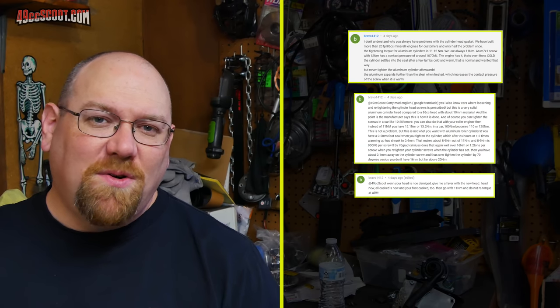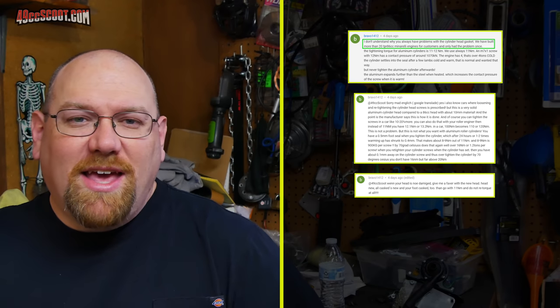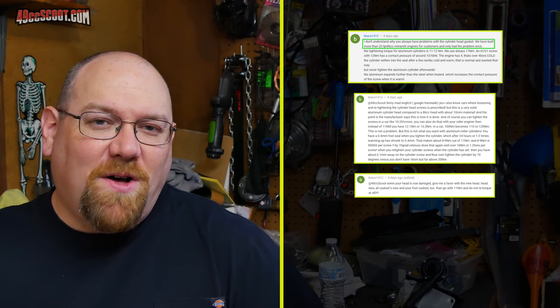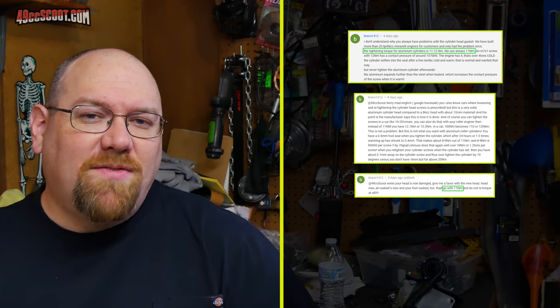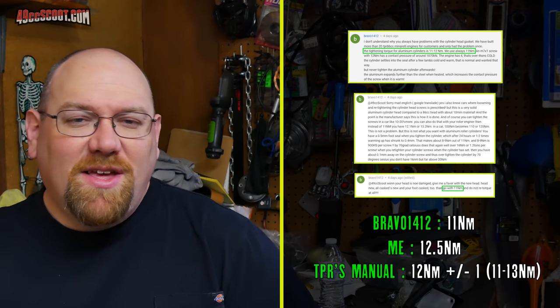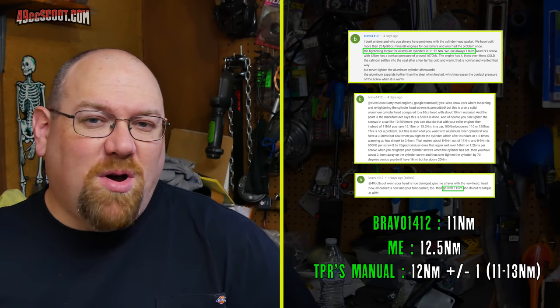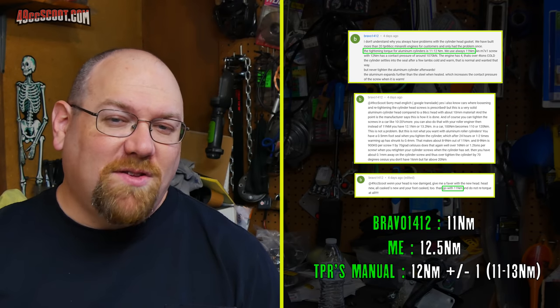But then I started reading the comments on one of my last videos, specifically comments by user Bravo1412. What he says is that he has done at least 20 of these TPR kits, and he's only had sealing issues like I'm having one time, so he believes that this is my fault because I'm applying too much torque or too much clamping force. He suggests that I use 11 newton meters as my torque spec for the cylinder nuts. I've been using 12.5, and TPR says 12 plus or minus 1 newton meter. So technically both of us are correct within TPR's specs, but he advises the low end of the specs.